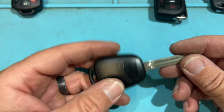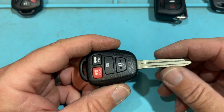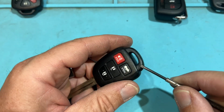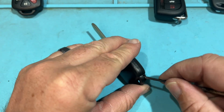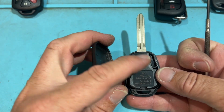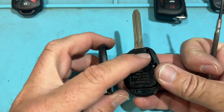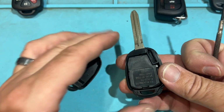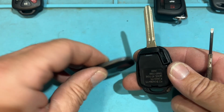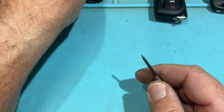This is like for the Tundras, the Camrys, Corollas, Highlanders, RAV4s, that type of key shape. It's like the 14 and up. Let's go ahead and look. Oh, there's our spot there. Let's go ahead and pop it open, and there's your chip as well. If you need to break that out, I see some super glue right there. It's going to be glued in there, so that's going to be fun taking that apart. You will have to damage here to break it out, but yeah, or you can drill it out, either or. Put it back in. Cool, buttons click.